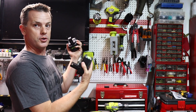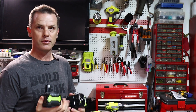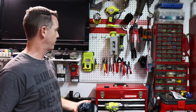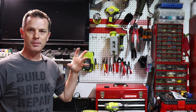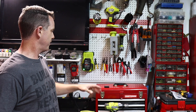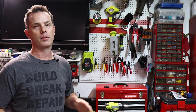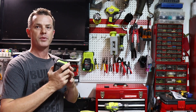The first thing you do when you get home is put them on the charger — they come with just a storage charge. I have several Ryobi chargers: the newer 30-minute charger and an older one that takes a bit longer. This is where I ran into my first issue. The six amp hour knockoff had no problems, but the four amp hour knockoff initially just gave a blinking red error light on the fast charger. I transferred it to the older charger, got a small charge in it, swapped it back, and it was fine. It hasn't happened since, but it did happen with that battery.